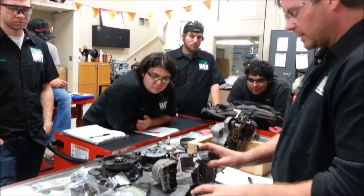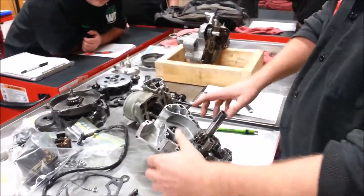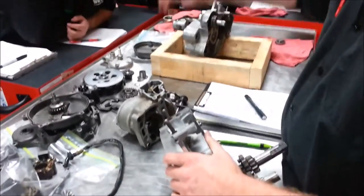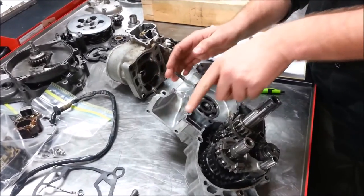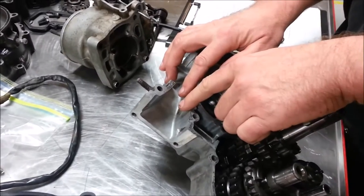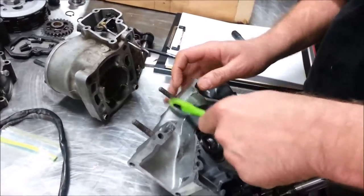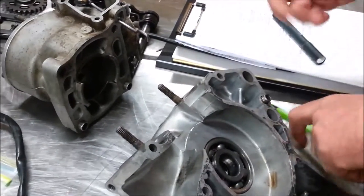What I would do is take my transmission out, take my crankshaft out, and if this requires a middle gasket or silicone, I would bolt and torque it together. Then I would grind all the aluminum so that it has a smooth transition from one case to the other. Imagine on the intake — when I have these two halves together with the guts out, I come in with a grinder and make sure there's no overhang or restrictions. I do the same thing with the gasket: you just take your hammer, put your gasket in place, tap it on that razor-sharp edge, and it'll peel right off and take the excess off.